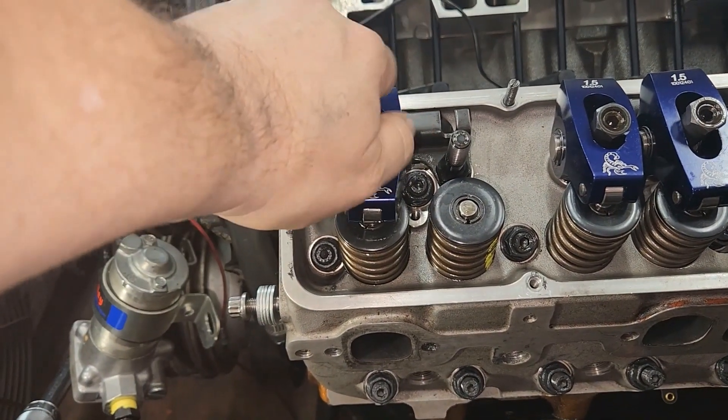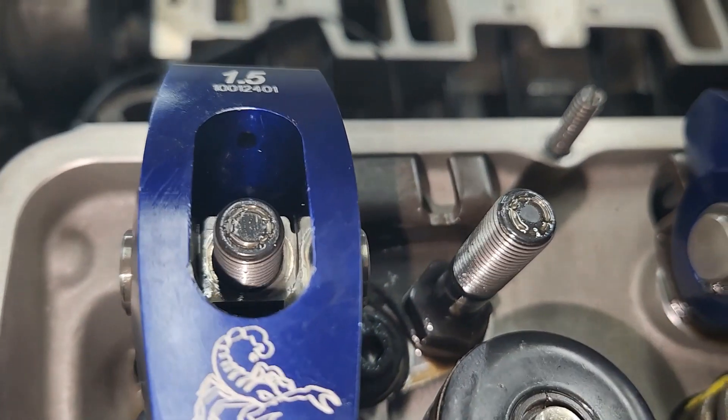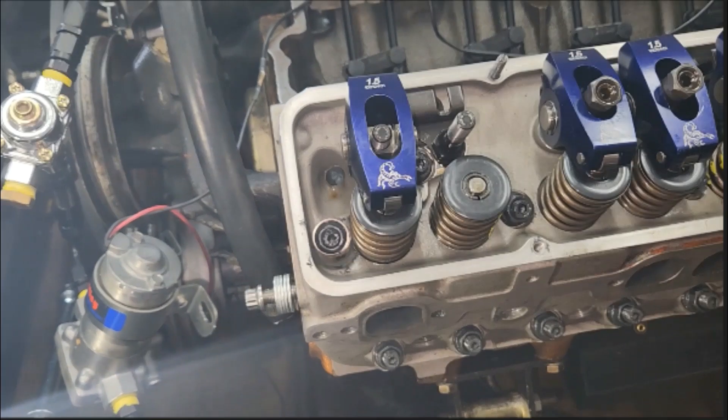This video shows that if we were to achieve the 90-degree angle with a longer push rod, it shows how much thread would be left on the rocker stud. You could get a longer rocker stud and you'd definitely need tall valve covers, which we do have. But I think the best thing is to pick a push rod length that gives a tight sweep in the middle of the valve stem. On this motor with these Promax heads and Scorpion rocker arms, the 90-degree method puts the rear roller tip way too far back. So I'm going to go with the 7.3 push rod and confirm by painting the valve stem and turning the motor over.